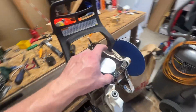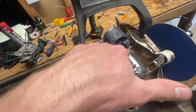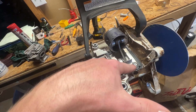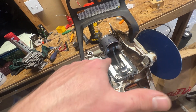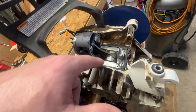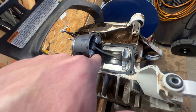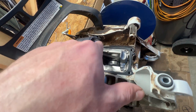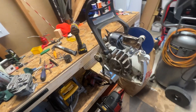The other modifications I had to do to this piston: I ground out all the little casting pieces so I could run the stuffer — there were four little casting pieces all the way around. Then in order to clear this crankshaft, I ground some material off and beveled it smooth on both sides, just to try to reduce a little bit more weight.